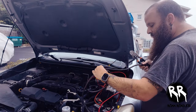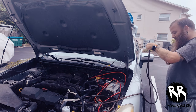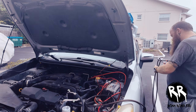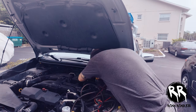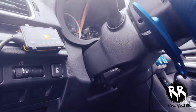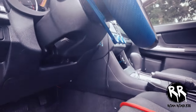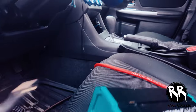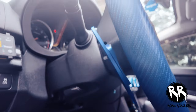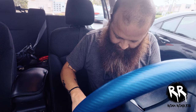I'm going to cut about half of the ground wire so I don't have to run as much through the firewall — I can estimate the length by comparing it to the power cable. I got the ground coming in from the starter battery and I'm connecting it to the input ground. The other end will run to the auxiliary battery and connect to the output ground of the DC-to-DC charger. Remember, nothing is actually connected to the batteries yet — I'm doing all that last so I'm not working with live wires and don't accidentally blow a fuse or get sparks.